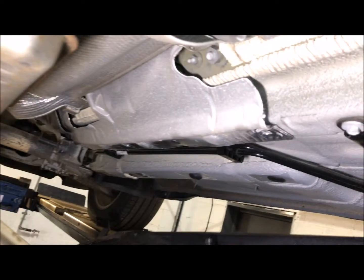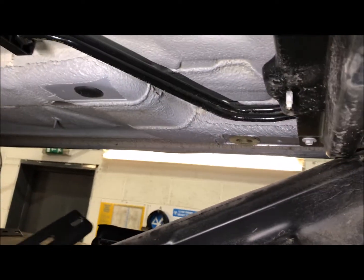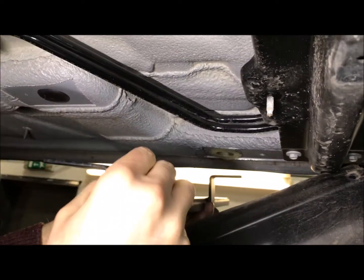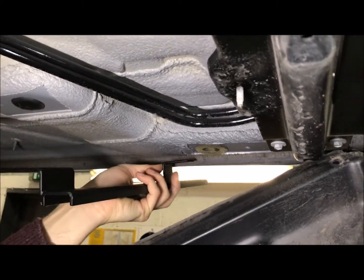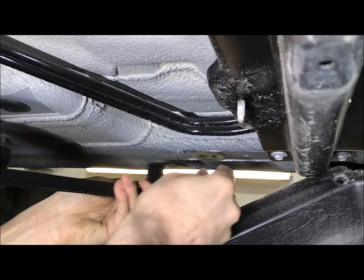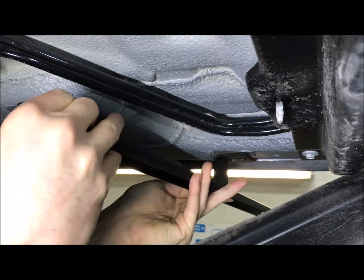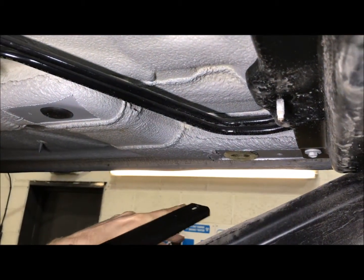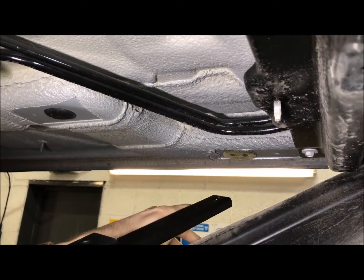Now I'm going to have to let this shield flop down, unfortunately, to show you the middle bracket. Now the middle bracket isn't dead central, but it's a bit towards the rear. So if you notice, it'll actually be at an angle slightly. This large grommet here and this small grommet here mean that when you put it on, the middle bracket is jutting out at an angle. It's not completely straight plumb line out, but it'll be sort of sitting out like that.